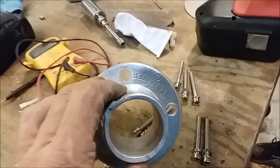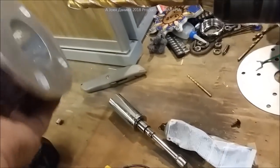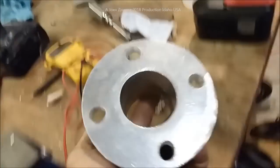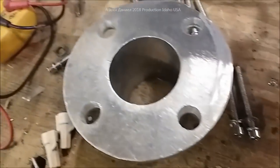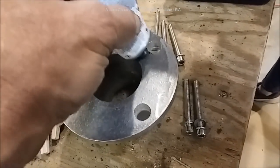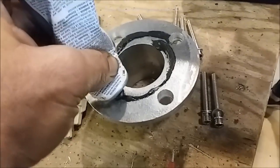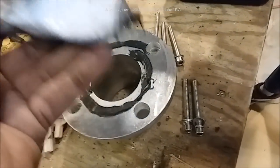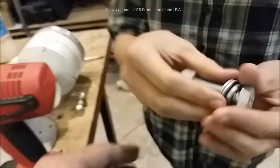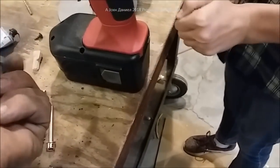All right, now we've got the holes drilled out nice, and I kind of gave them a little bit of side angle with the drill so that they're nice and clear. We're going to be putting a little bit of RTV — just a little bit on the inside of this fitting right here — just to keep it from getting a little leak down towards the wiring. It'll squish out pretty good, so I'll get that on there, and she's working on getting the bolts all set up.